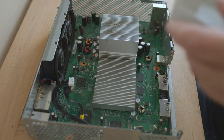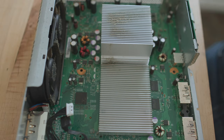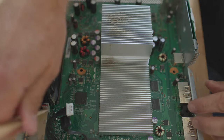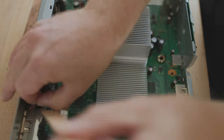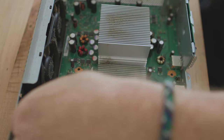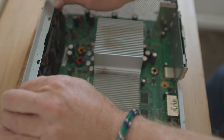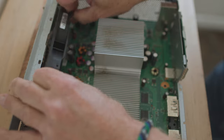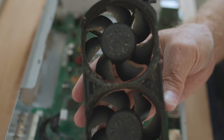Underneath the shroud I see the fans — they're pretty dirty. The plug that powers the fan has a little clasp on it. I just put my little tongue depressor in there, give it a little twist, and out pops the plug. The fan is held in place with two little clasps — you can see the little black nubs sticking up into the metal housing that pinches the fan down towards the motherboard. I find just pushing up on that piece of metal releases the clasps from the fan. Then pull the fan towards the heat sinks and up and out — it's ready to be cleaned.